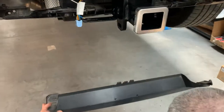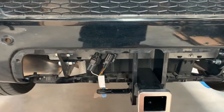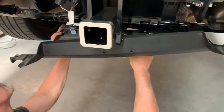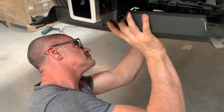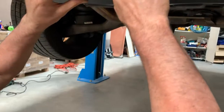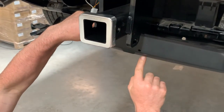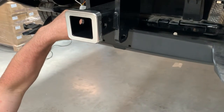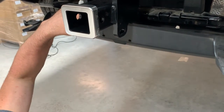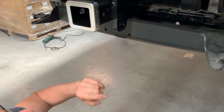We have to cut a section out of the two cowlings. The bumper is back on and everything is in gear, and we've actually plugged the wiring in. The instructions show 100mm by 100mm, but we're going to start lower and see where we go — I'd rather cut less out and do it in two stages. We've marked the lines, come down to this groove, drilled the hole, and we're going to use a Dremel to cut a section out here.